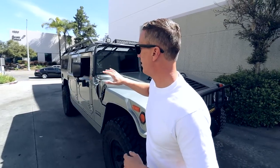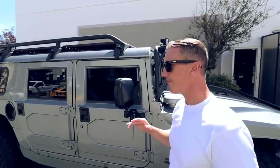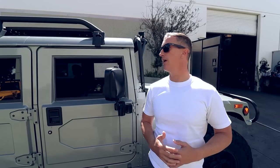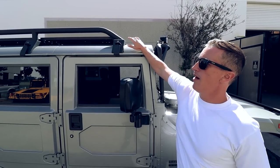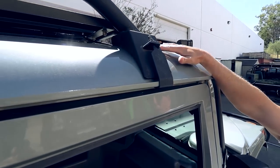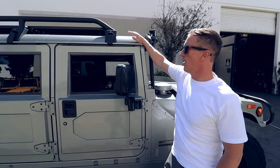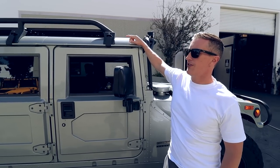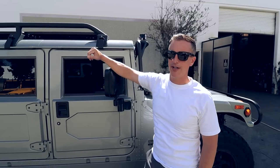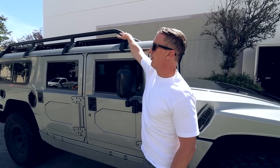This one in particular isn't our oldest design — I'll show you another version, a similar version, a little bit different with the rain gutter clamps, and I'll talk to you about why that is not the best way to go. But this is one of our original low profile roof racks. The design behind this is an actual radius footprint that mounts on the radius of the roof, and what that does is it distributes the load evenly on the truck. This is one of the first designs out there in the Hummer industry, and a couple of other industries have picked up on it implementing a similar, much lower profile design where it sits a little bit lower.